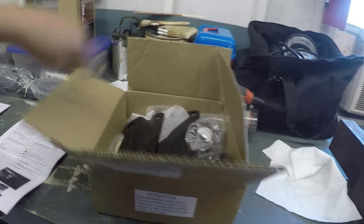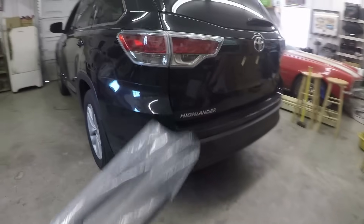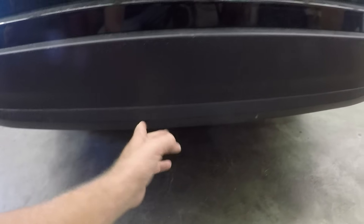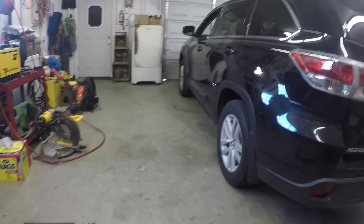There's a box full of bits and pieces, parts and hardware. Got a couple of pieces here of trim that go on the rear bumper. Once you get up under here, you're actually going to take — there's a section that separates right here. You take this piece off and this piece goes up in here and replaces it, giving you a little cutout for that bumper to fit up in. So this rear bumper recesses up a little bit and you have a little plastic step plate on the end of it. That's why I went with this one over some of the aftermarket ones that just hung down. It's a Toyota part, and on a brand new car like this I would rather go with something like that. So anyway, we'll take you through the installation and we'll see how it goes.